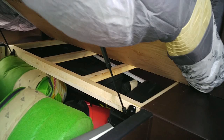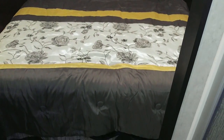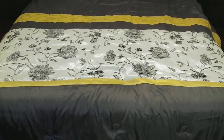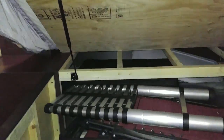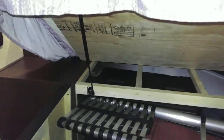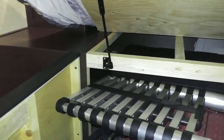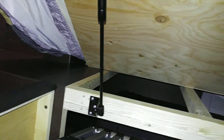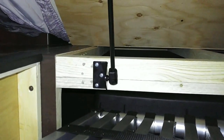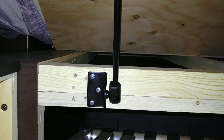Here's the result. It used to be a real pain to lift the bed and find a stick to hold it up — and the stick could fall and hit you in the head. The large bed lift kit as-designed really doesn't work with this Forest River. But with one little toe push, it holds up just fine. The original kit's top bracket and hardware worked at the top, but the bottom side-mount hardware didn't give enough lift, so I went to a trailer store, bought another strut ball with a right angle, put one on each side — and now I have a bed lift kit. Woo-hoo!